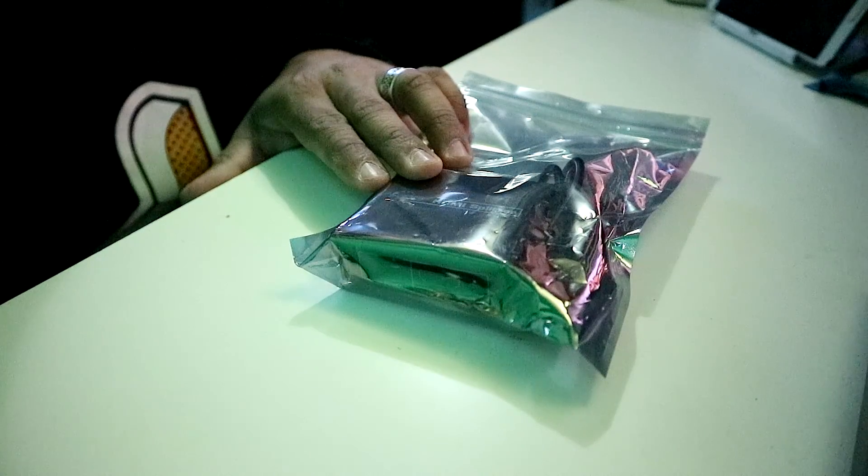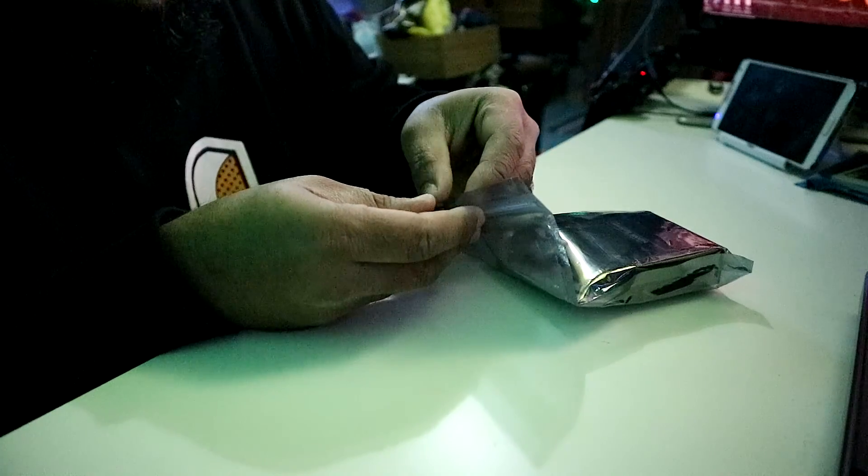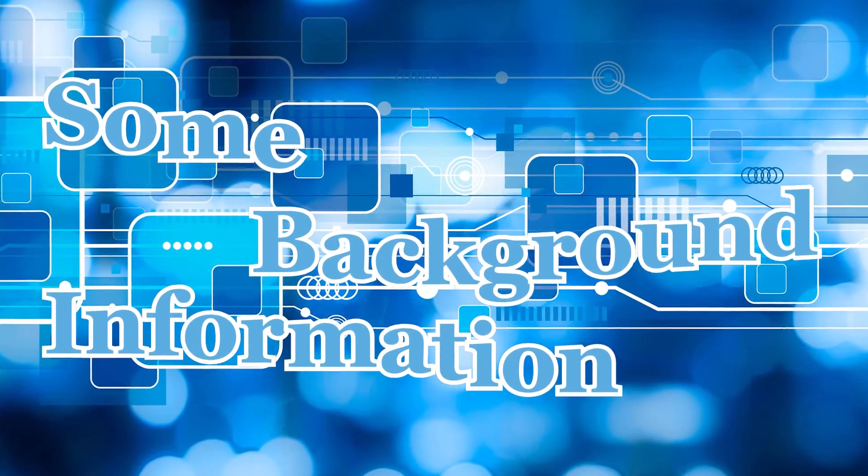This is an HDMI splitter. Generally, all it does is split an HDMI signal. If you haven't been playing your PlayStation 3 with an HDMI cable — which many Elgato HD users haven't — it's because you can't actually send a signal from a PS3 through HDMI due to the HDCP automatic handshake that occurs between the PS3 and the Elgato. Sony built this hardware to prevent piracy — for example, copying a DVD directly — but this setup is a workaround.